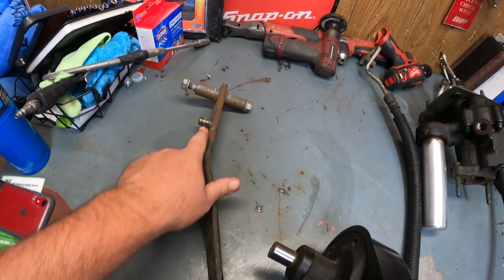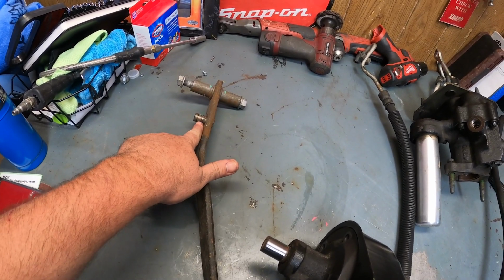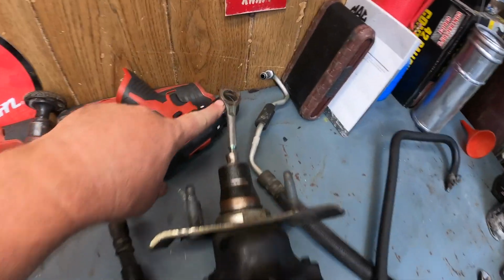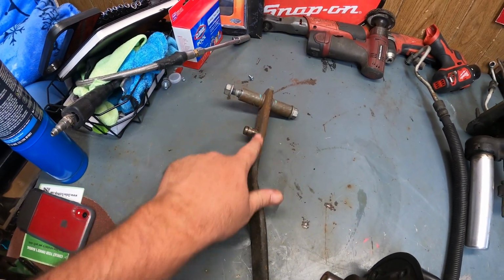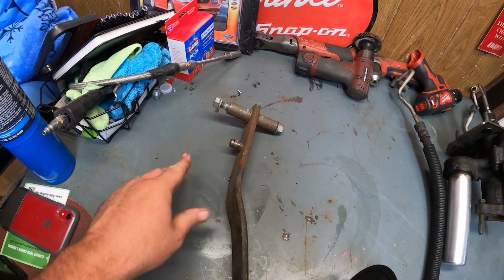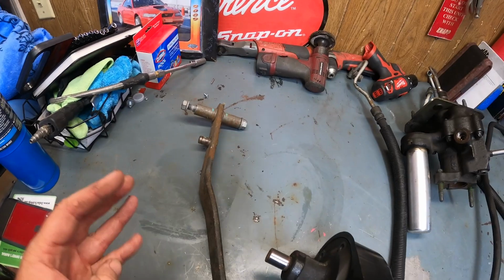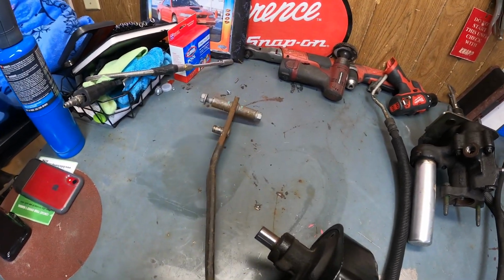You will also need a vehicle brake pedal that has HydroBoost on it. Pedals are essentially the same, except this mounting lug right here, which goes into this eyelet. It is in a little bit different area, so there's a little bit different lever action on that. So definitely need to get a pedal as well.